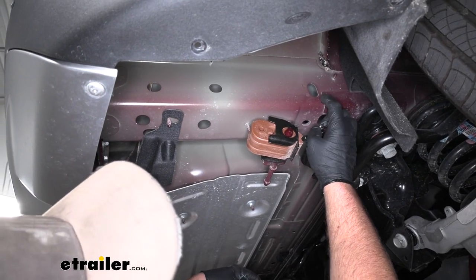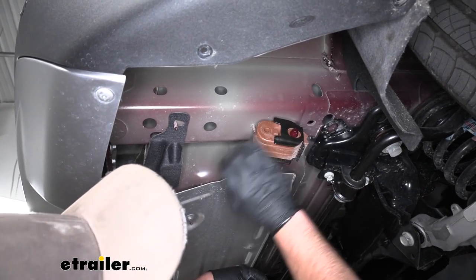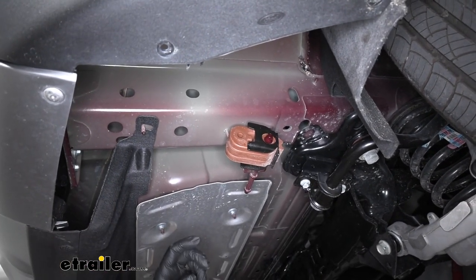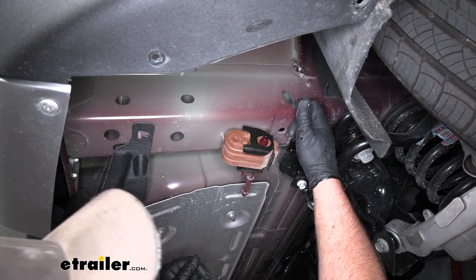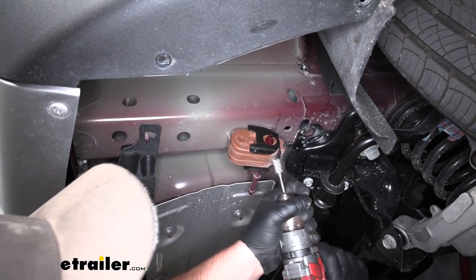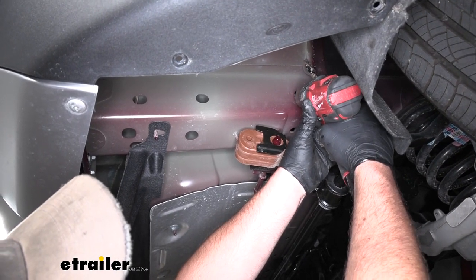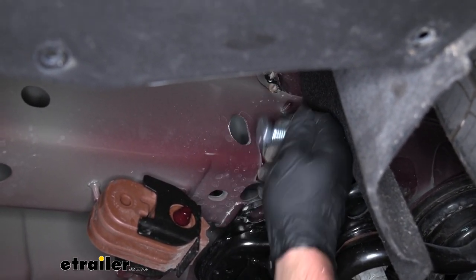Once both sides are removed, adjust the strap as necessary to give us the space we need. On the side of our frame rail, we're going to have an oval-shaped hole closest to the front of the vehicle — we'll use this as an access hole to get our hardware inside the frame rail. The problem is the head of the bolt is too big to fit through there. You can either try to pry on it a little to make it bigger, or — what I prefer — just enlarge it using a hand file or a rotary tool. Remove a little bit of material and make it just large enough to fit our bolts through, checking the carriage bolt fit periodically.